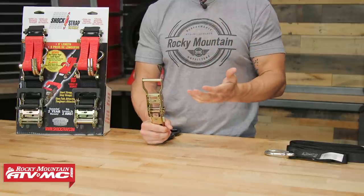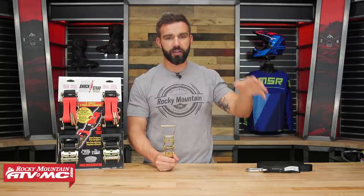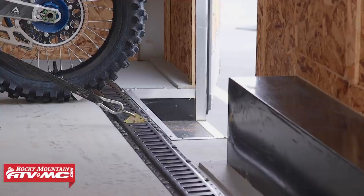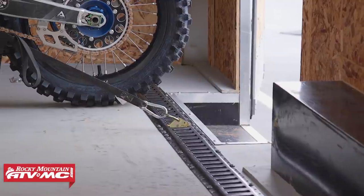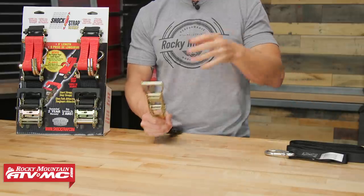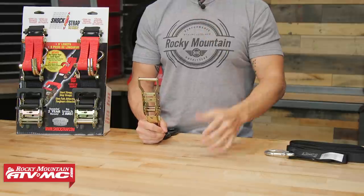A couple of extra tips before we let you go: don't think that if you're doing an ATV or UTV you can only use ratchet tie-downs. What we'll actually do sometimes is use a buckle style in the front and ratchets in the back to really crank it down and get nice and snug. Or if you're tying down a motorcycle and want to make sure it can't roll forward or back, use a buckle style in the front and then take a ratchet and put it on the rear wheel — that way you've got tension from both the back and front. That's why it's always a good idea to have different tie-downs for different situations: keep a few buckle style and a few ratchet tie-downs so you always have a good combination.